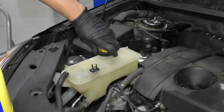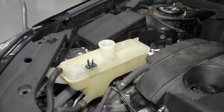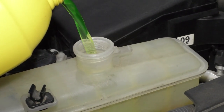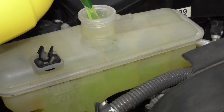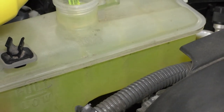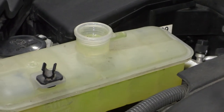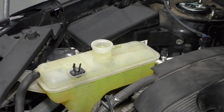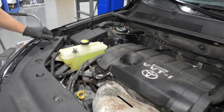After this job, you're going to want to make sure you take the coolant cap off and top off the coolant. If a lot of coolant came out, then you're going to have to bleed the system. Use the appropriate coolant — check your owner's manual. You can use a funnel if you want. Fill it up and let it run while monitoring the coolant system for about 10 minutes, with the heat on low, watching the temp gauge. Shut it off after 10 minutes, recheck the level, and put the cap back on.